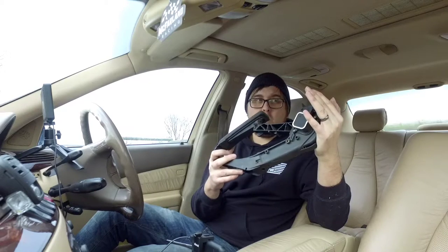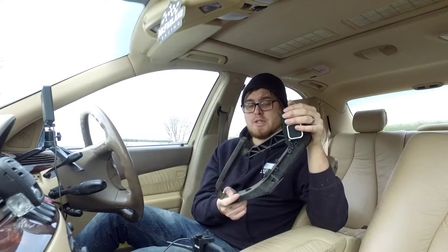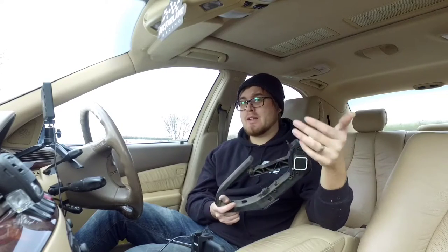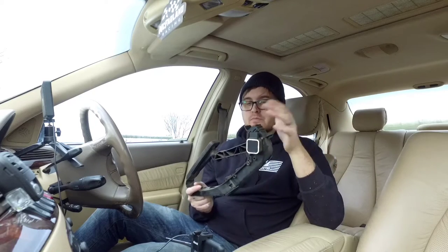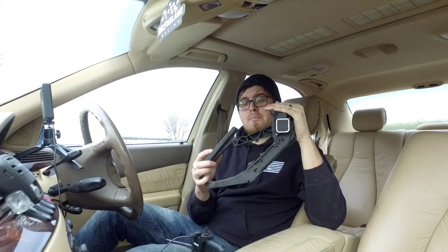Often from what I've read, people report that the car's sticking in fifth gear. I'm not sure how true that is - mine didn't, mine stayed in the gear it should be in, but it just wouldn't rev up. Or if I held the pedal down for a long period of time then it would rev up. So I've got a used one of these on the way - yes you should replace it with new genuine, but the quickest thing I could get was a used one.